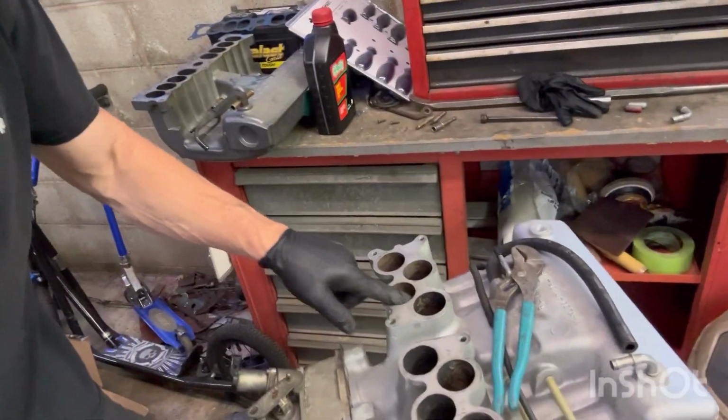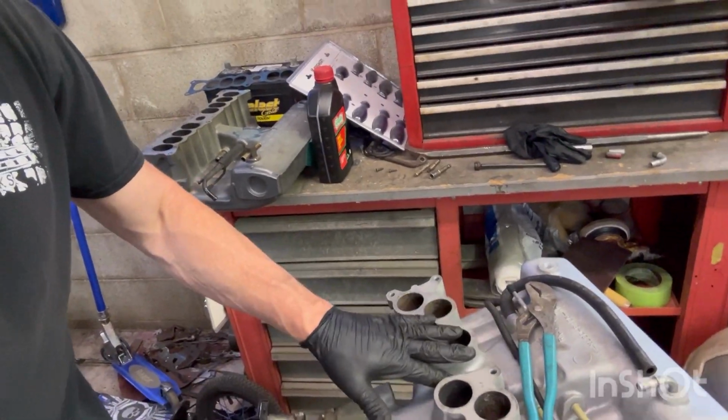It doesn't have the EGR bottom hole. And the intake is split. So I think this is an early 97 model that didn't have the EGR or whatever. I don't know. Haven't got into that. But anyway, you can drill and tap that hole on the motor as long as you got a good shop vac and take it slow and easy. All right, I'll show you when I get done with it.